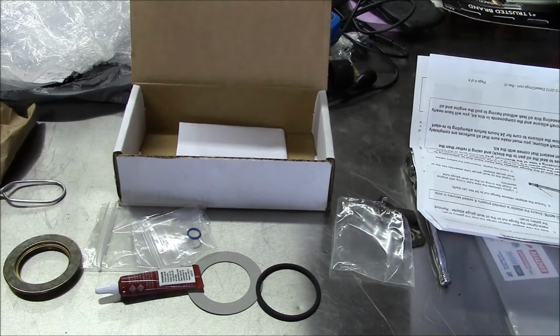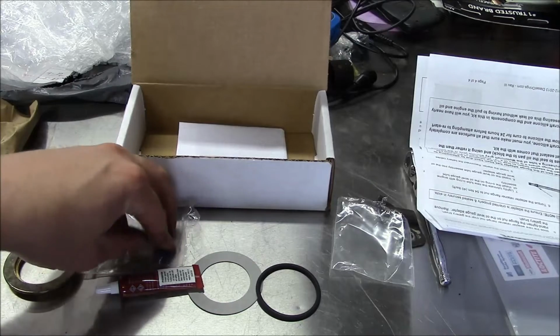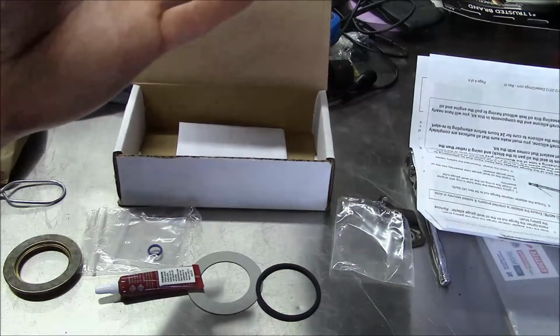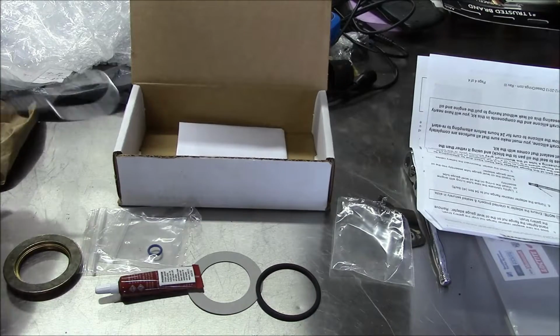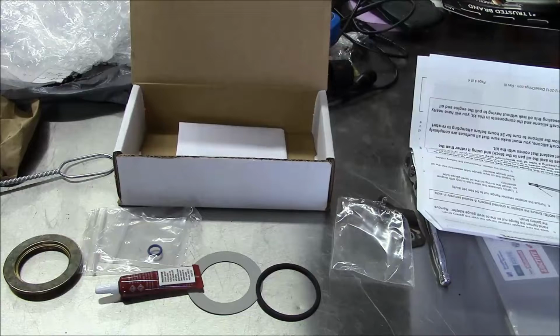And the oil pan, I believe, does not have a gasket. It uses RTV silicone, so once you crack that thing off there, you gotta clean all that up and reapply the silicone and set the thing back up there. And actually, if you read the Ford manual, it tells you to do it with the engine sitting upside down. So let's not do that.